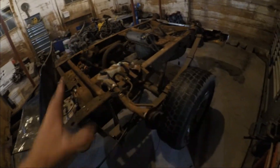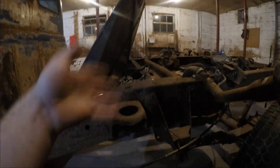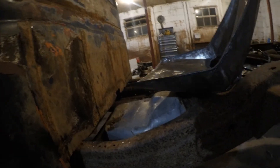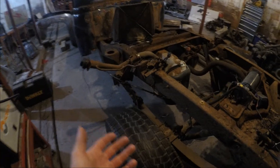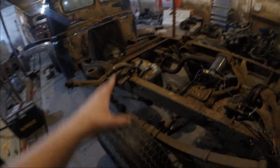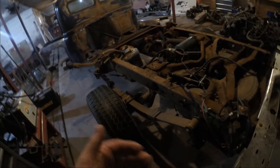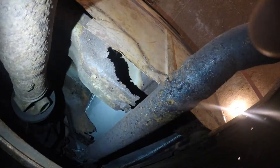The best way I see us doing this — also because the frame is rotten on both sides from right to here — is basically cut it, zing zing, like we did on our 1996 F-150 short bed conversion. We'll cut it there and make our own frame basically up to our short bed spec — I believe it's a 115-inch wheelbase. We'll reuse as much of the F-150 parts as we can but we need new hangers and small stuff like that. I was planning on shortening this truck anyway; we just need to make a custom frame from the cab back.